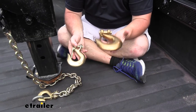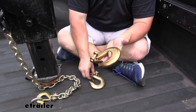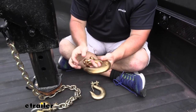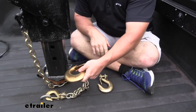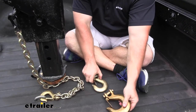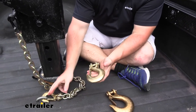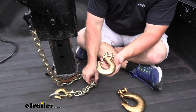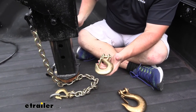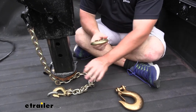Our other two sizes: the half inch one is obviously way too big for what we're going to use it for today. I think it's used more for a crane or to lift up a load like that — you wouldn't use it for a safety chain loop or the back of your hitch; it's just not going to fit. We have the midsize three-eighths, and that one would probably work with our safety chain loops and chain. It would fit our chain definitely, but it doesn't match the hook I have on the other side — I wanted to keep the five-sixteenths on both sides, so that's why we went with those.